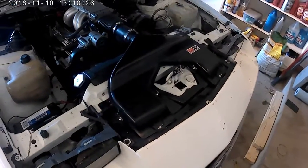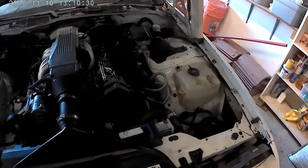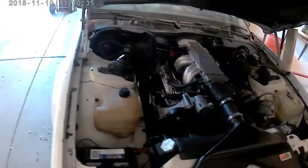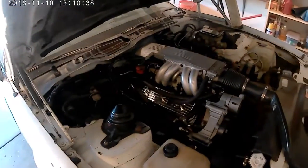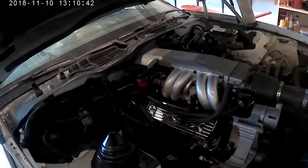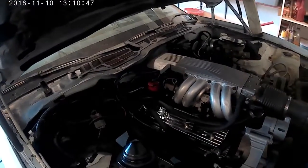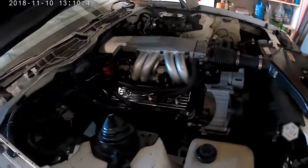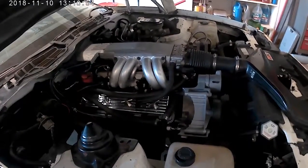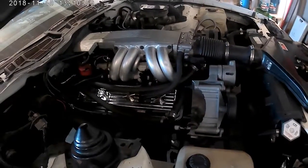I tried to use the original air cleaner and had to get a little creative with the fuel lines — braided fuel lines. So: '87 engine, '86 manifold. We went with about an '88-'89 distributor that had the external coil, which you can see there, just to clean it up a little bit more. The last video showed the car running after the injector swap — it had a couple misfires from clogged injectors, but these are the new Bosch units at 22 pounds per hour.